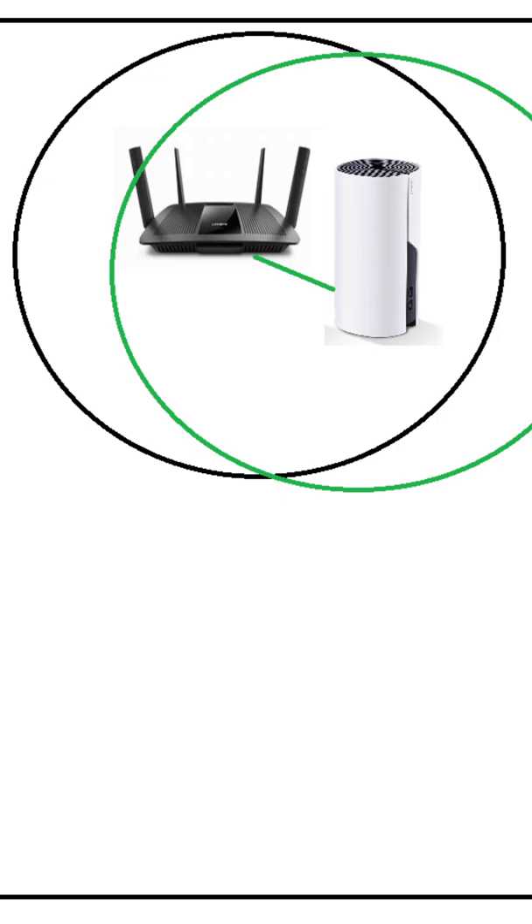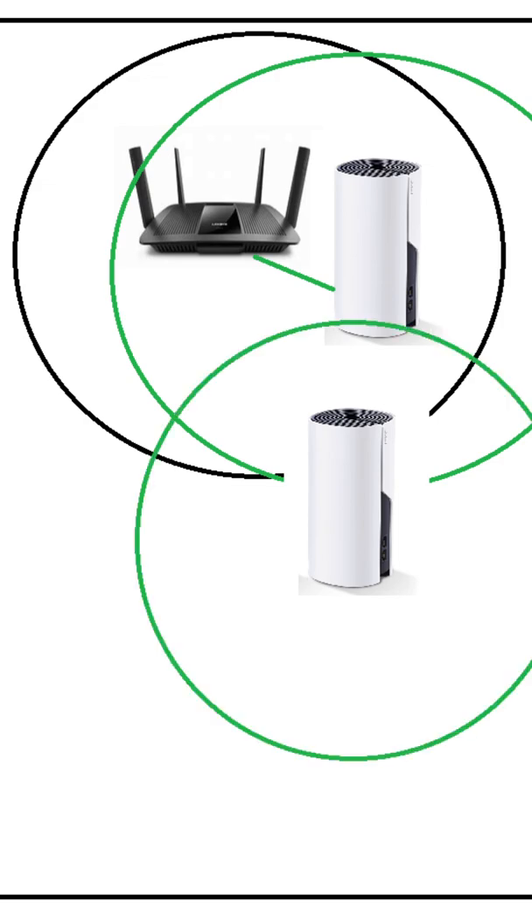So what's the point of this? The point is you can add more nodes. The two nodes will connect wirelessly — you can wire them, but they'll use Wi-Fi to talk to each other and maintain good signals. That second node can emit again, and you can keep adding more and more across your house at different levels — upstairs, downstairs, or different parts. As long as each one can talk to the next, you extend the range bit by bit. Buying more of these Decos allows you to extend the range, and you can mix and match them as they've all got different capabilities.